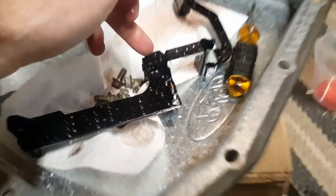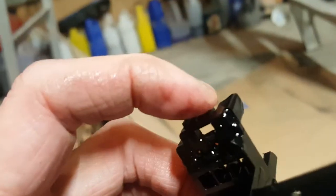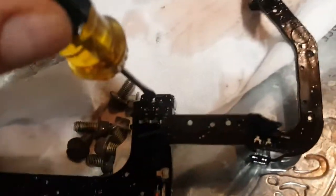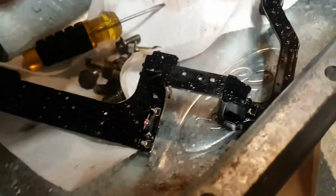This plastic piece across the middle - the only really tricky spot - is where there are three electrical connectors that got really sticky. You put a screwdriver in this little hole and push out. It's just a tab; push with a screwdriver and pull up, but you have to really wiggle it. The others came off not too bad. Use a small tool, slide it in, push lightly - they're surprisingly weak - then wiggle until it comes up.